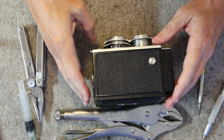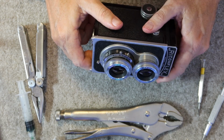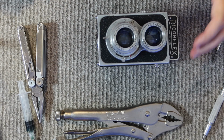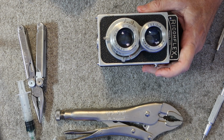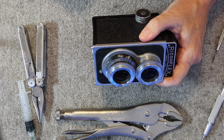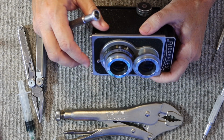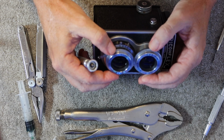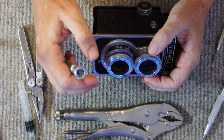You can also use something like 3-in-1 oil or whatever and let it sit overnight. That'll work to get them loose. Or if you're lucky and you live in a place where you have access to penetrating oils, I forget the name, PB Blaster, that was the best stuff which I used to be able to find in America, but which they don't sell here in Japan. That would make quick work of these things, smelly and messy as it is.